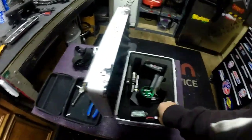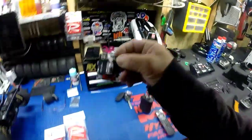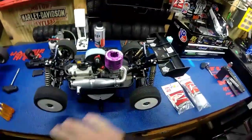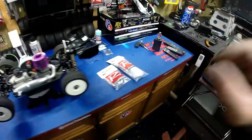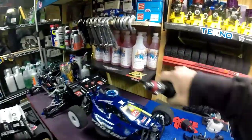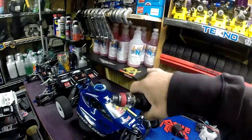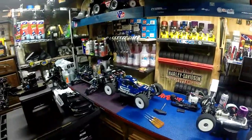Getting my stuff ready for race day. I picked up four more of the Red's TS3 Ultra Hot plugs - I recommend those for the Novarossi P5s. It takes away that ghost flame-out you get. Could be running perfect idle, everything great, and then bam - stops running. That's called a ghost flame-out. The hotter Ultra Hot plug will stop that from happening. You've got to have a good tune, but it'll work. Got my Bones Brew re-upped - got my first order in of 30/10, and going to 38 or 39 for my next order.